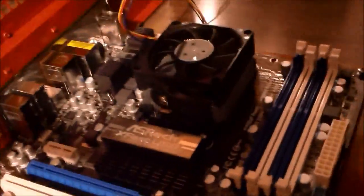It's not terribly hard. But if you were into hardcore gaming, or you're going to use this for more than just a drone, I'd recommend scraping off this thermal paste and getting some Arctic Silver. It's better. So don't touch that. Don't get any dust on that. You want it to be perfectly clean. So we'll put that on next. Alright, and that basically just clamps down on there. There's a little clamp type thing. The plug plugs into the place that says CPU fan.